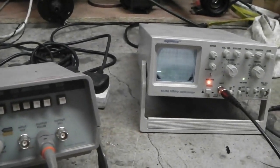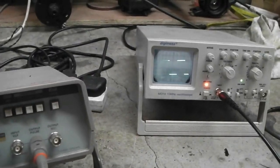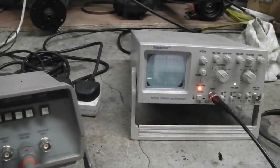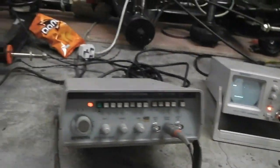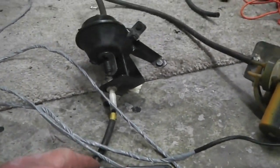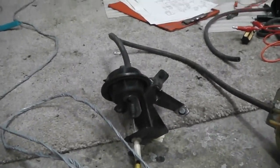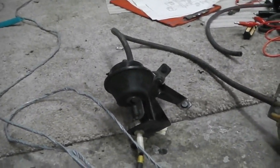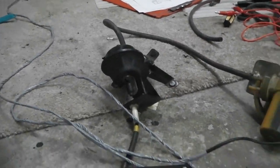Down to, say, just dropped out then as well, because it recognised an error, the fact the car was slowing down even though it's got the revs on. So that's a slower speed, which we now set. Doesn't go as far in now. Just stops about there because it doesn't need as much rev. So that's how it is.